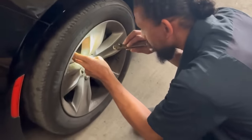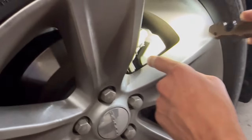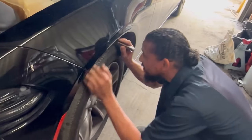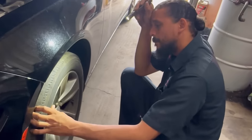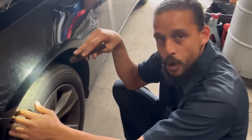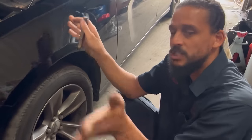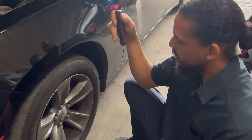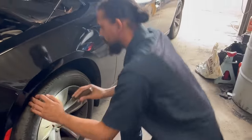Looking at the rotors, yes, they do look like they were changed about a year ago. The pads look pretty good. I am going to take it for a test drive, but I always make sure the car is safe first. It does need tires very bad — this is unsafe. The purpose of tread on tires is to disperse water away from the center so the tire won't hydroplane. When tires float, you have no control of that vehicle. Don't drive around on bald tires.